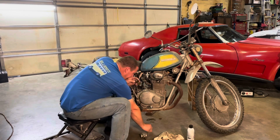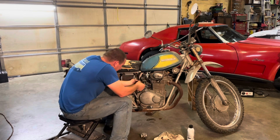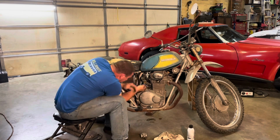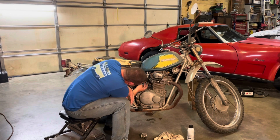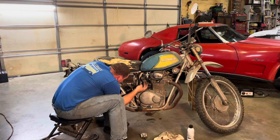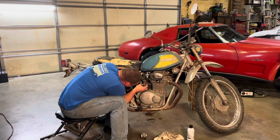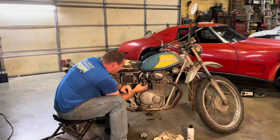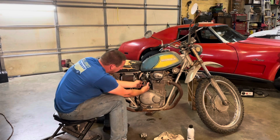Okay, I am trying to figure out what a good fuel or float level would be, just where it'll shut off and have an acceptable amount of drop. I don't have a needle in it, I'm just kind of eyeballing it. Okay, that got rid of a lot of the overhang. It got rid of a quarter inch of drop. Fairly confident the students have been in here messing with it, based on the fact that this fuel bowl is clean.